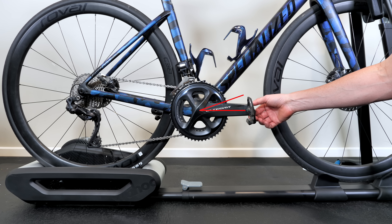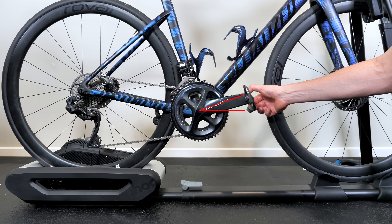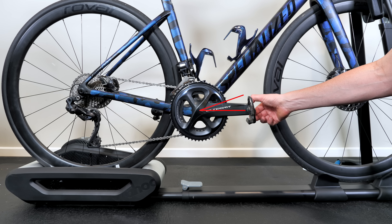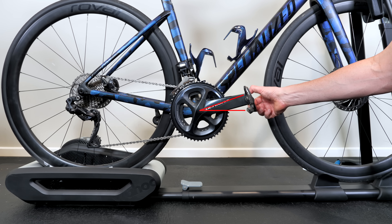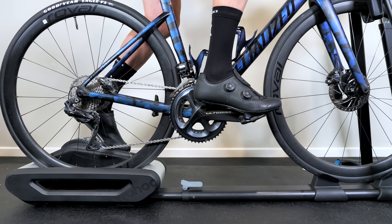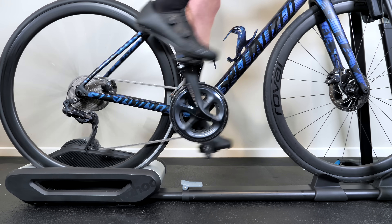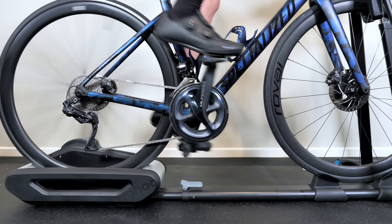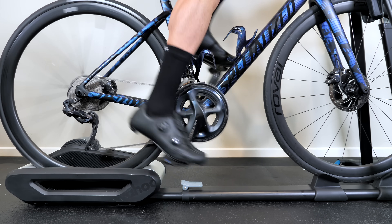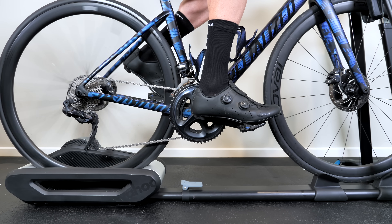Okay, what I have here is Mrs. Llama's bike with a DT Swiss 350 rear hub with an 18-point engagement ratchet, and there's a lot of free air that the crank has to move through before the engagement locks into place. There's a lot of nothing happening right there before that engagement kicks in. When clipping in, the pedal moves without the rear wheel moving — and if the rear wheel was moving, you've got to chase that engagement even further. When pedaling along and coasting just for a moment, you've got to chase that engagement over — you can hear the click — pedaling through that backlash, through that angle, before the engagement really kicks in.